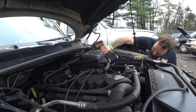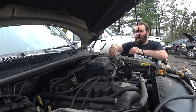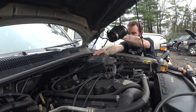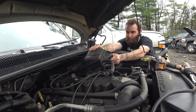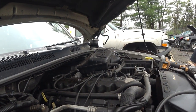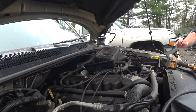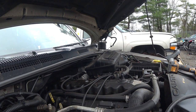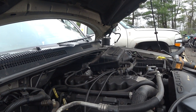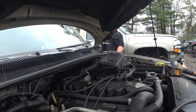Jimmy jam this guy off. In case y'all are wondering how to get to your throttle body — like this. You got a bolt on this side. It's a 10mm. It's been amateur hour, but I got news for ya.